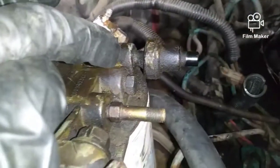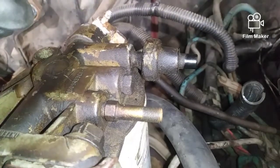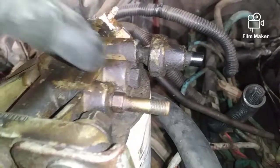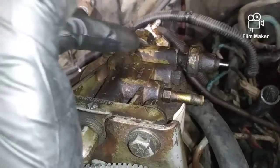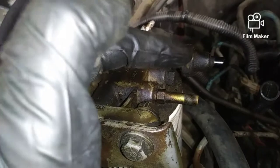And then the green wire that has a red stripe on it, he goes to the vacuum switch. It's also just a fuel filter clog switch, same thing. But what it does is this runs off of the pressure in the housing, and if it's clogged, basically there's some magic ports happening on the inside of here, and it will tell you that your fuel filter is clogged, and it just pushes it back. There's a little diaphragm in there, and yes, it does leak.